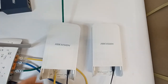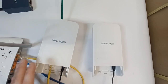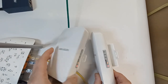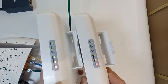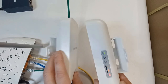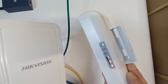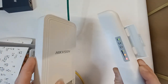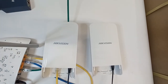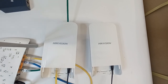Here's our physical setup. This bridge is still connected to the network side as it should be, and I've unplugged the cable from the other one. Straight away the signal lights came on — once you see those signal lights, that means they're paired and linked up. The light turns green, confirming the connection. To deploy, you unplug the second bridge from the network and take it to its remote location, and they will pair together wirelessly.